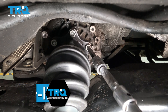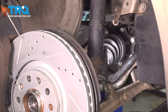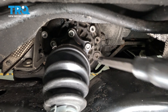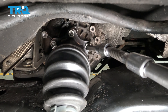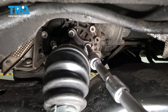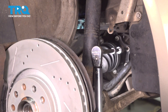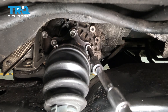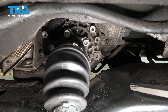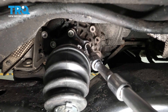Torque that. Now we'll rotate it again 180 degrees. Torque this one down. This is just to make sure it's evenly torqued. Put the screwdriver in the rotor — 40 foot-pounds. Now it's even. Now we can just move on to the next bolt and go around and torque the rest of them.